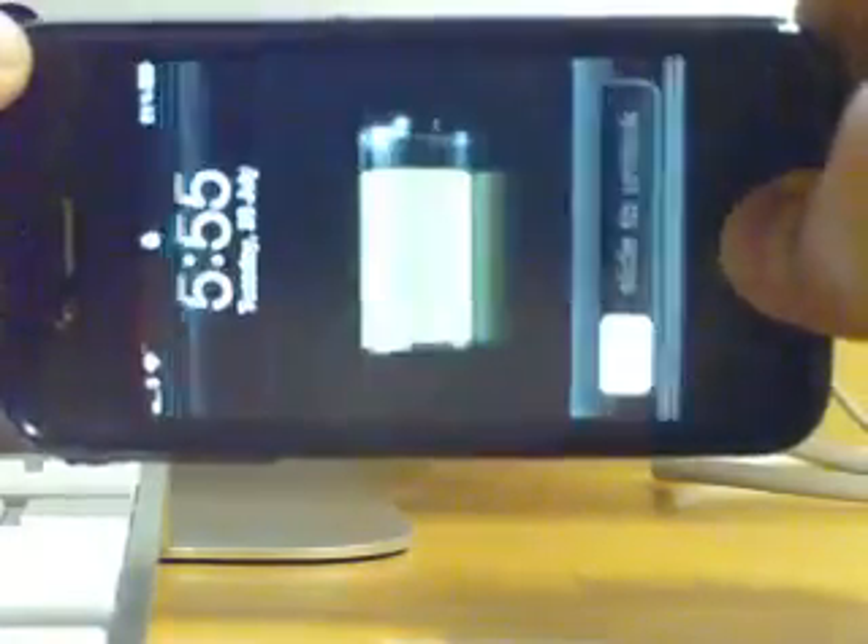We're now going to put my iPhone into DFU mode. We'll do this by holding the home button and the power button for around 8 seconds, then once the screen goes black, release the power button and continue holding down the home button. I accidentally hit my next button and clicked the next thing on redsn0w — don't worry about that. Hold for around 15 seconds, and it will come up with a message; just ignore that.